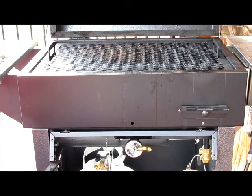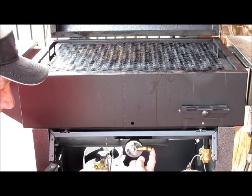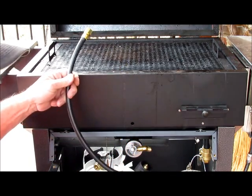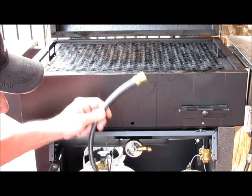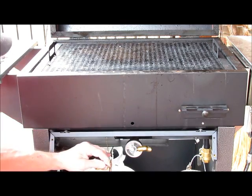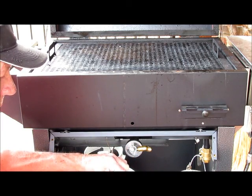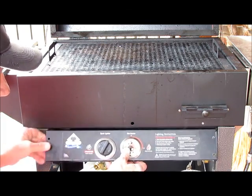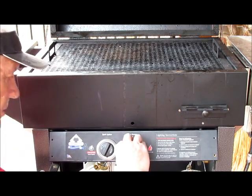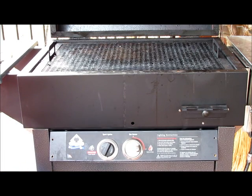There you go — it's not moving. Since we were converting it to natural gas, you'll take your gas hose and connect it directly into the gas valve. You don't need the regulator if you're converting to natural gas — that's only for propane. Then connect your gas line to your supply and reassemble everything: connect your igniter wire into the igniter, put your four screws on, assemble your gas knob, and you're ready to go. You're ready to start cooking, and that's how you change the orifice in a Holland grill.